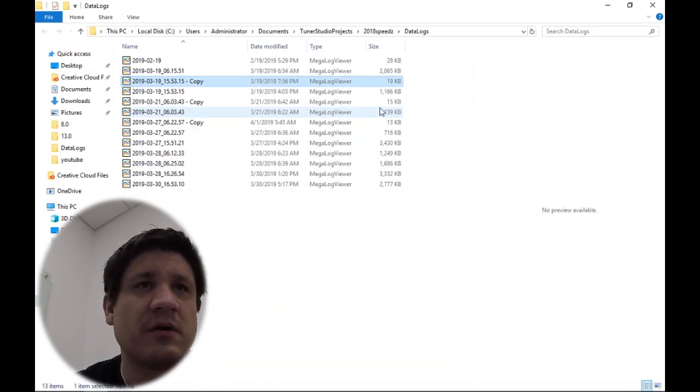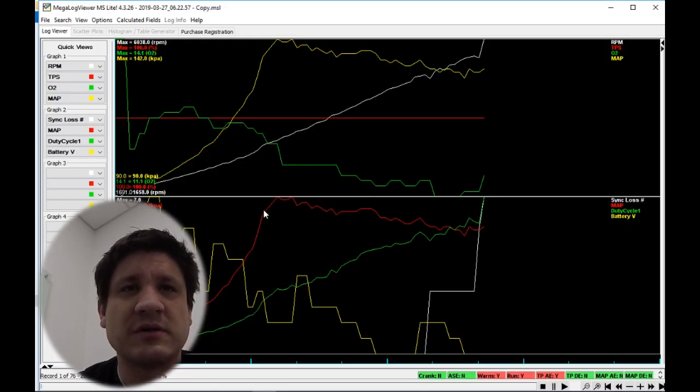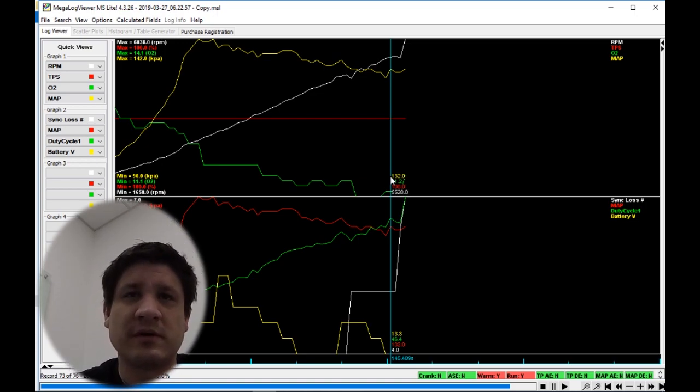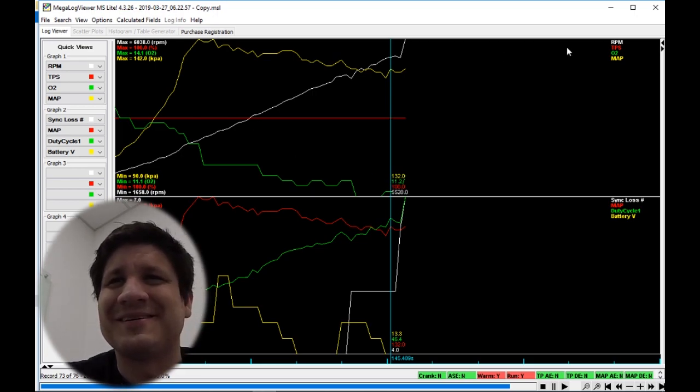Here's a more recent one. All I did was a bleed valve and I kind of set that in there. You can see it did kind of the same action. The wastegate hits its initial pressure — this time I took it up to closer to 142 kPa. But by the end of it, it's dropped that 10, bled off from there. It's about 6 psi before, closer to about 7. It's time to get that boost valve wired in, so that's coming up.